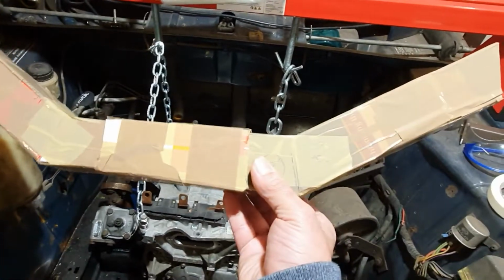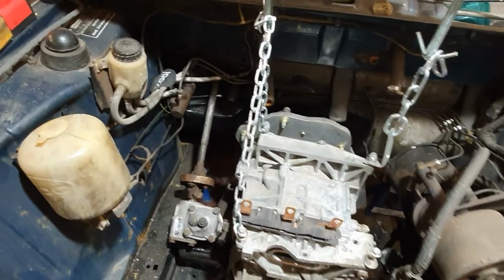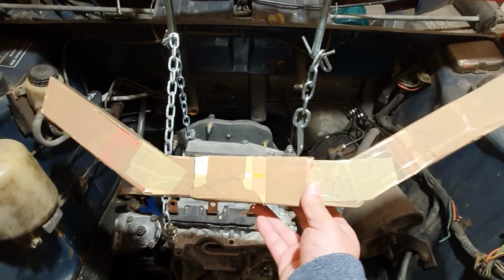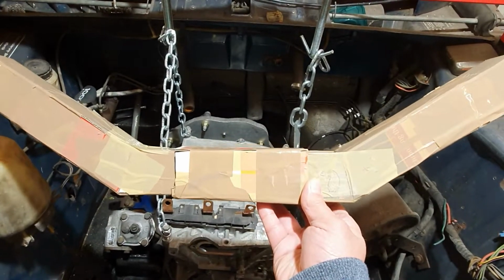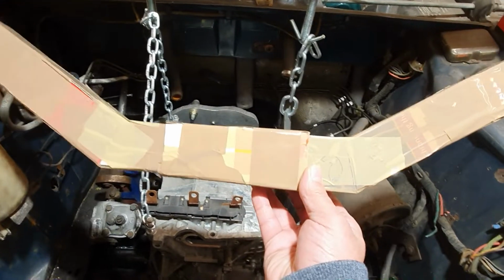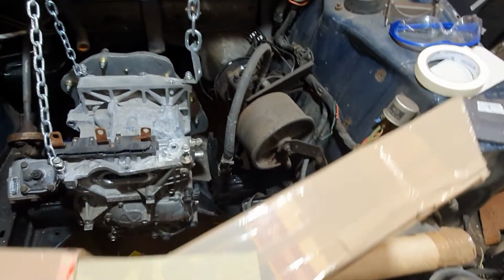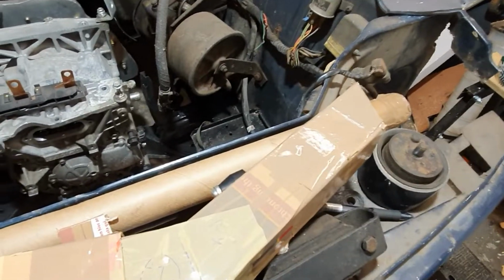And then I'll transfer this onto the tube that I have, and the weight of the motor, and probably some other parts as well, maybe, I don't know yet. So this is what I'm planning on doing. I'm going to get under the car, and because this is sliding, I want to get the middle bottom bar approximately the right length, then tape it off, then I know that's fixed. Then I've got a saw that hopefully cuts metal. We're going to transfer this onto the box section and start cutting some tube.